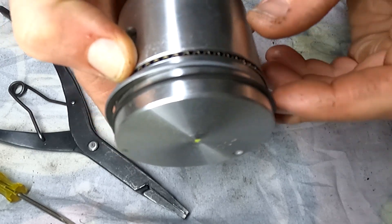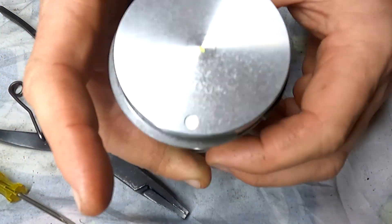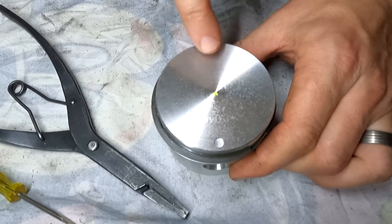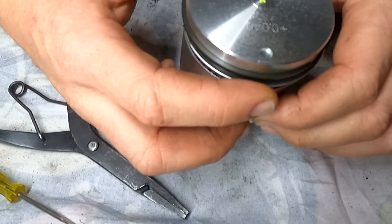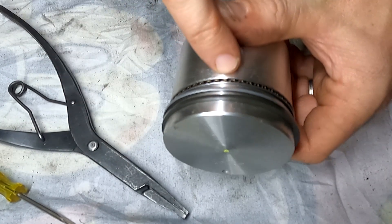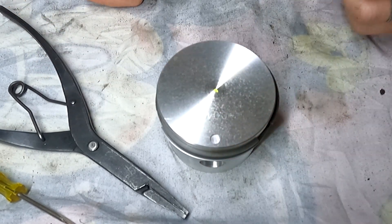Slowly rotate it all the way around. Fantastic, and that's it. Here's our clock: 12 o'clock, 6, 3 and 9. So the first one is at approximately 10 o'clock. The second one is approximately 2 o'clock. The third one is at the 6 o'clock position, and the other oil control ring flipped on the other side is at the 12 o'clock position. So we are halfway there.